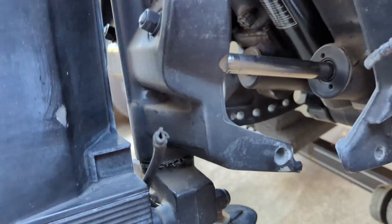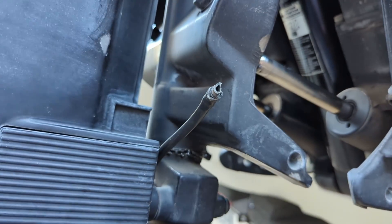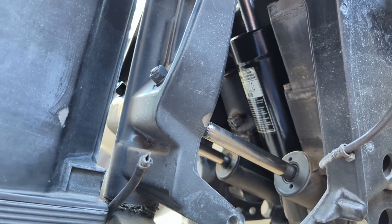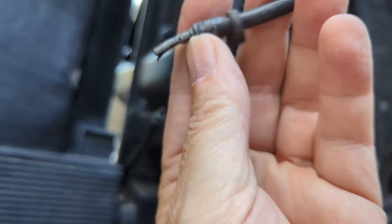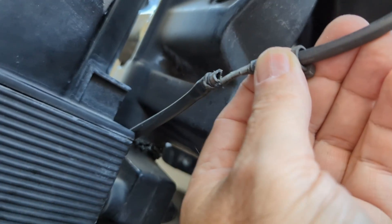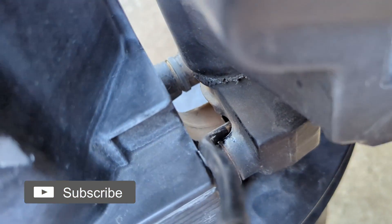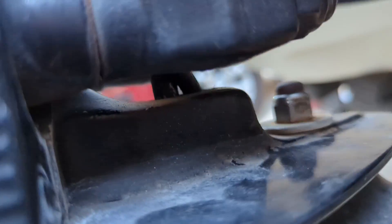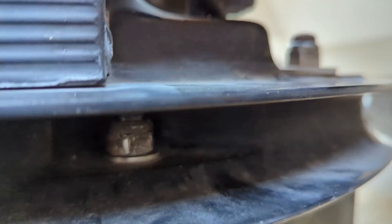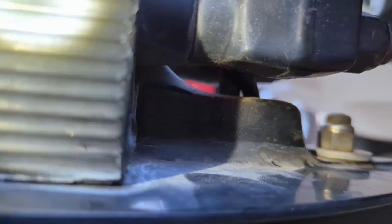Now one other issue from the first time I had done this: this line is the water pressure that goes back to your console and tells you how fast you're going — mine hasn't worked for years. There's a plastic coupler and mine's been smashed for years. This time when we took it apart it actually broke off. You have to remove this because it will just go right on down in there — it goes in some holes, right next to the shifter.